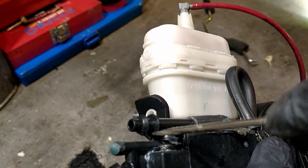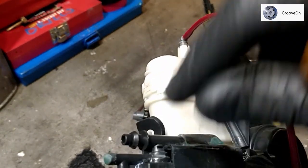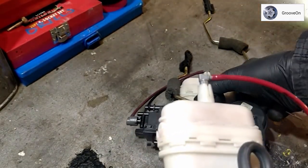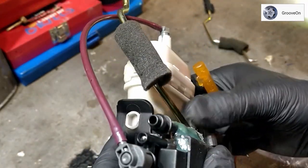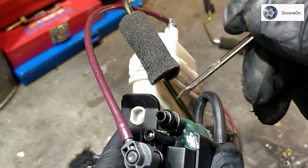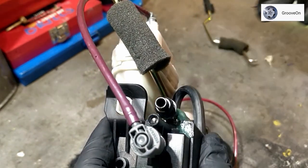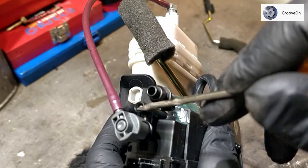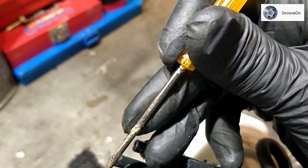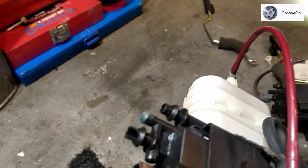The second place to check is at the end here — not where you connect the pneumatics and air supply from the vehicle, but just here. There's a little ball bearing at the end, which you can see on this unit. I'm not sure if it's part of the manufacturing process or for factory testing, but that's where it can leak and needs sealing. On this other unit I wasn't careful removing the connector and ended up breaking it.